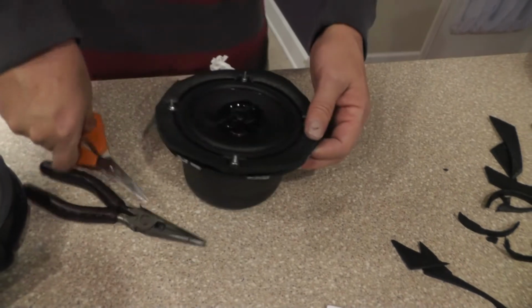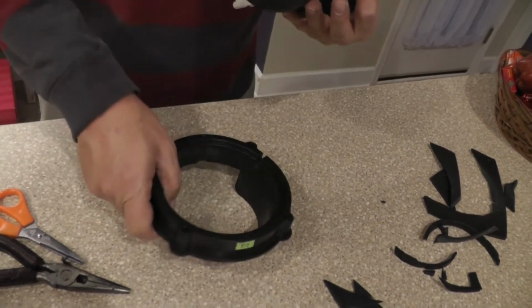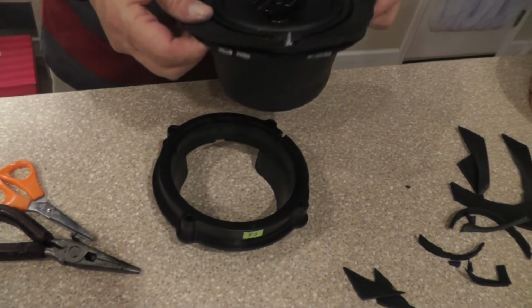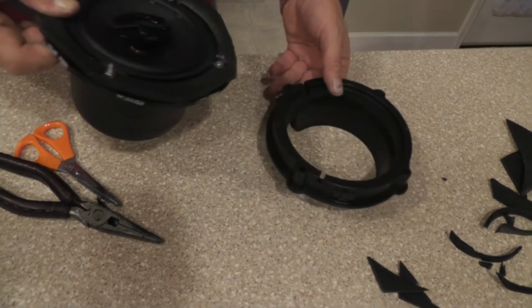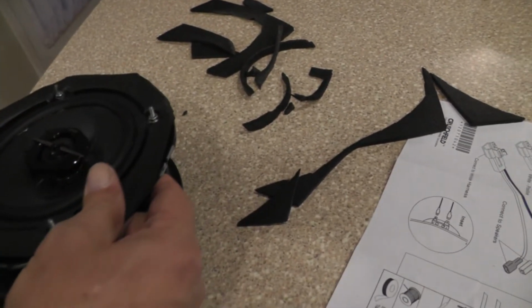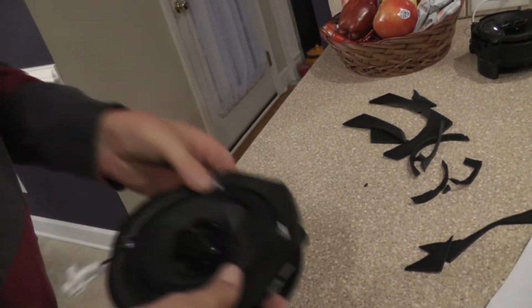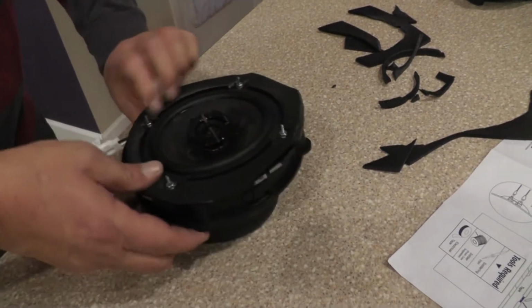Okay. Now we want to do the same thing again. When we put this in, we want to cut the back. So remember, get our dowel pins at the top. Okay. Remember, our connector is going to be on this side because we're on the right hand side of the door now. So I want my connector to pass through. So I'm going to just lower them down and just push them on down in there. Make sure he goes in the notch, which he does. Okay.